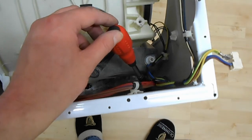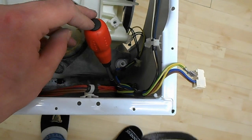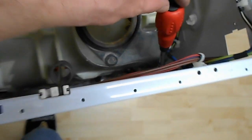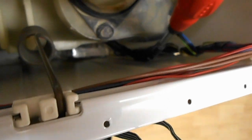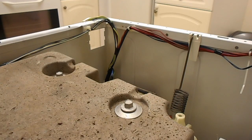Right, so again, by pushing the drum, I was able to actually see the end of this, and it's a 7mm hex headed screw right down there. So you can get a crosshead into it, or I've got this bendy thing and it's allowing me to undo it. So yeah, that screw, there's like a lip in the back of this seal and it's kind of like a clip which holds it under the drum. So yeah, you see there, you can get it on the camera, it is turning and going in. It's not particularly tight, so that was for... Right then, let's see if we can...